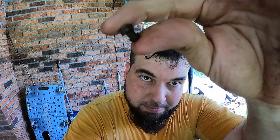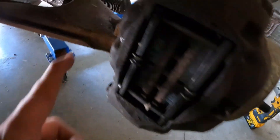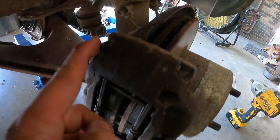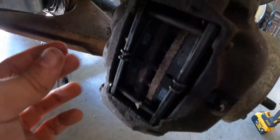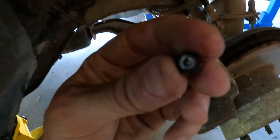I just had something unfortunate happen. One of my bleeders — this caliper has one bleeder for each side and one for a high point. All I did was break it loose and snug it back, and as I was snugging it back it just sheared off. So now I have to dig out the old one — hopefully it digs out, or I'll have to get a caliper.